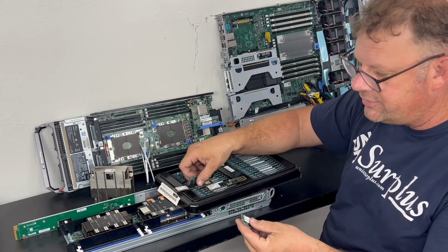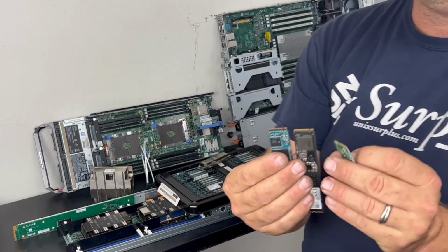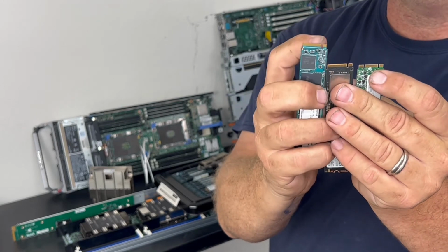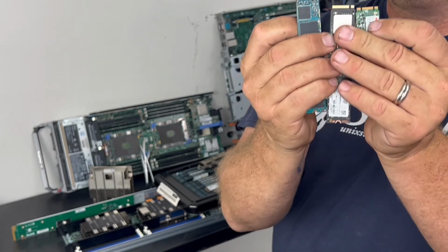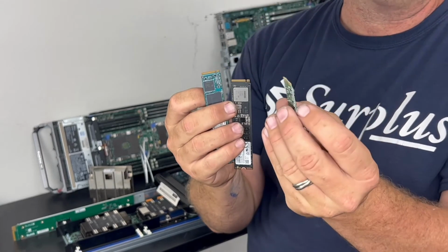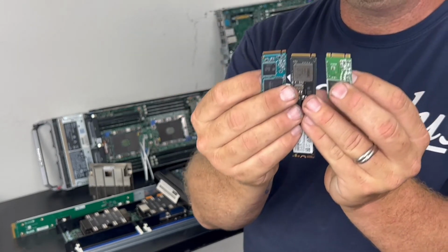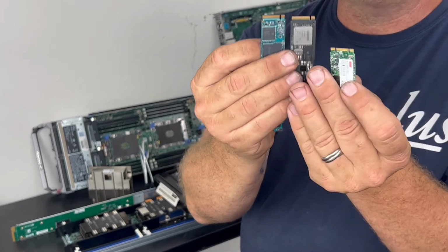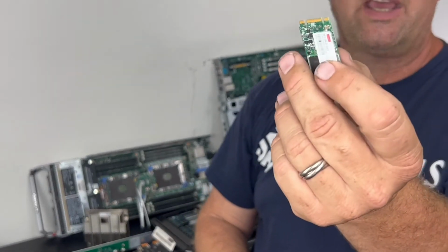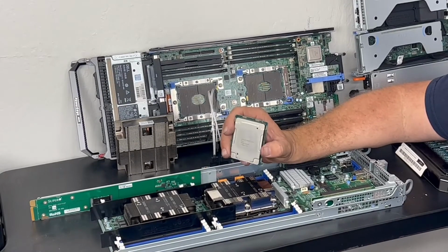A little note about all these different drives. If you take a look at them, there's differences. These are the enterprise drives, and they have 2 notches. Here, just one here, 1 notch, 2 sections. You find 3 sections over here. The 3rd section is proof that it'll also work in SATA mode, right here. So you can see the differences in the M.2 boot notching, and these are PCIe only mode, and these here are SATA and PCIe.